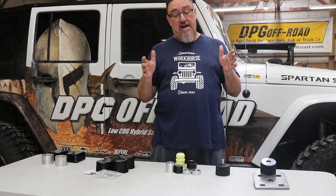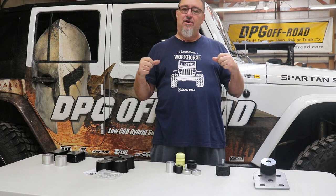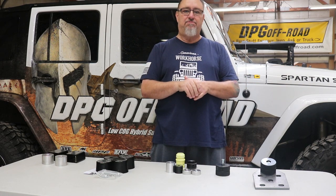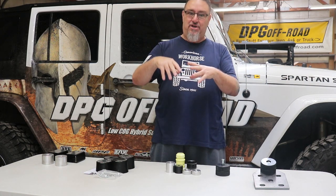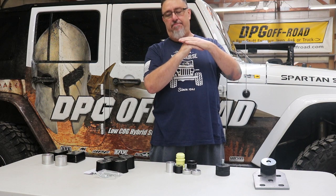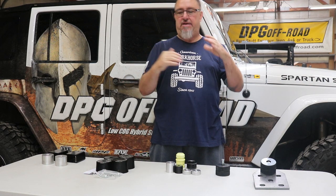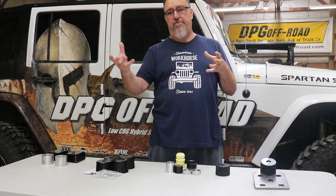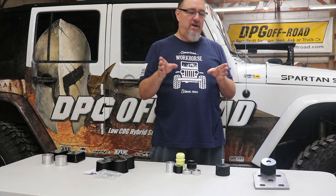There are a lot of misconceptions and objections when it comes to bump stops. I've talked to thousands of people over the years about lifts and bump stops, and when I ask what they'll do for bump stops, they say they don't want to mess with it. When I ask why, they say they don't want to limit their up travel — they're afraid extending the bump stop will limit the up travel. Well, there's some truth to that; bump stops do limit up travel, that's what they're designed to do. The question is how much do we limit it.